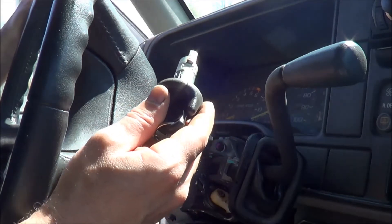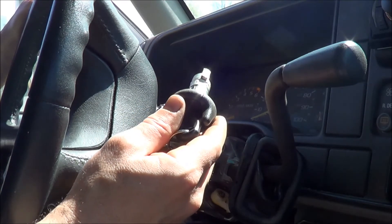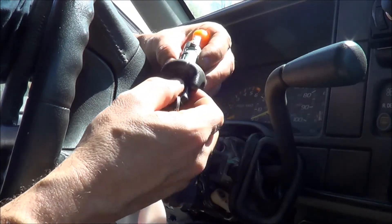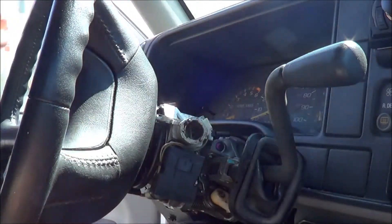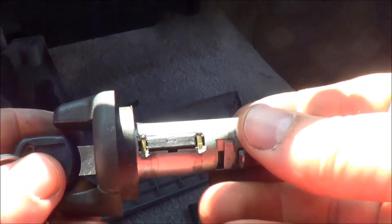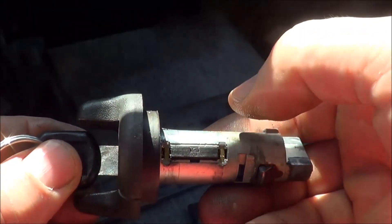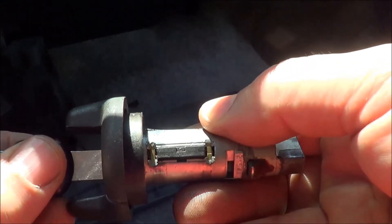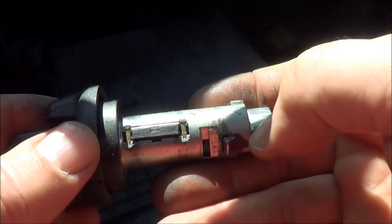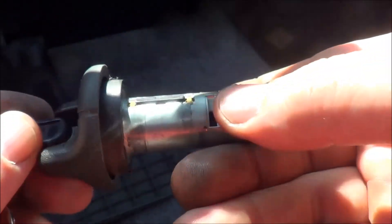This key was not stuck in there — my truck's was. This one was hanging in the start position and I really didn't want to chew up my new starter, so for about $20 you can get a whole new lock assembly. When these go bad and stick, the springs underneath go weak — that's where the tumblers are. When you push the key in, this little plate is supposed to drop out of the way and allow you to turn the cylinder over to start the vehicle.